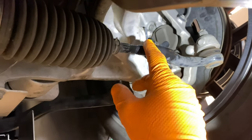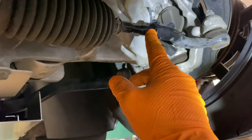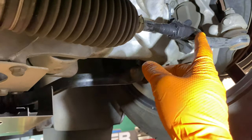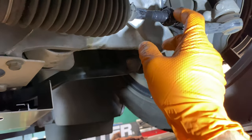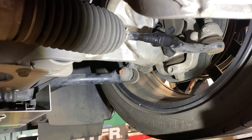And then one thing I would strongly recommend, grease the threads. Wipe the grease off so there's residual grease inside the threads. Put electrical tape over the outer tie rod and the adjustment nut, and that will help from this rusting into the threads or seizing in place. Gives you a good example right there.